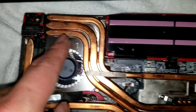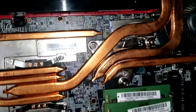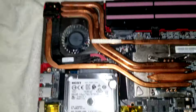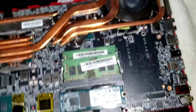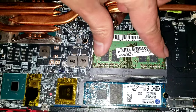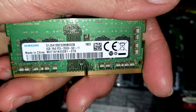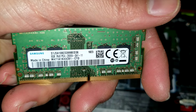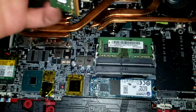And then you can see the hinges are just held right here. This is the battery — it looks actually pretty small for this laptop, but most gaming laptops you don't really use on battery because it can't use the graphics card. And then you've got the RAM — just push those two clips aside. It looks like this uses PC4-2666V, so that's the RAM you'll need if you want to upgrade it.